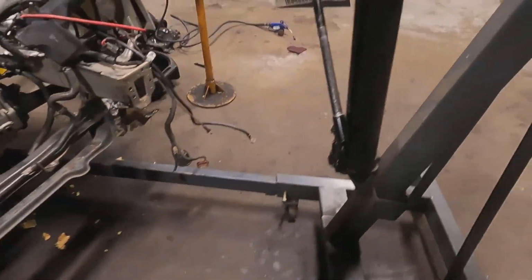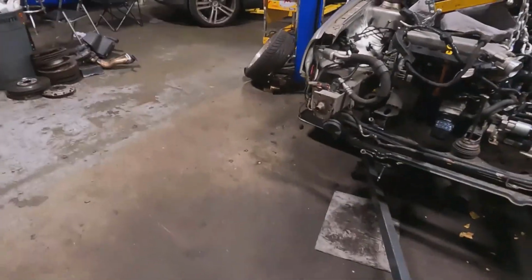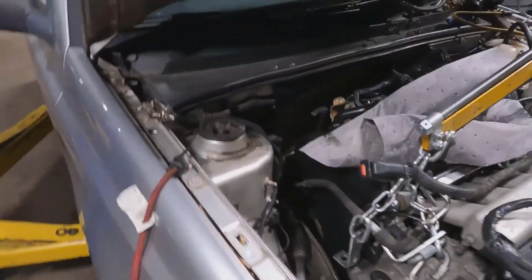So I just have to kind of leave some tension on the engine hoist. That way I can start all the bolts. You know, you can't just go hammering bolts in like this. Everything sits into its own place. So I'll just relieve some tension with the engine hoist, take one drift pin out, and just run a bolt in hand tight. Then go to the next one, then let the engine down where it wants to be, then tighten them all for good. But we'll be bang bang shooting in no time with two-step when it comes in.